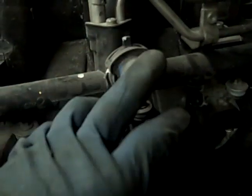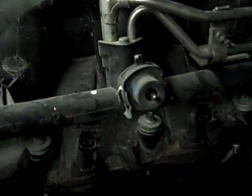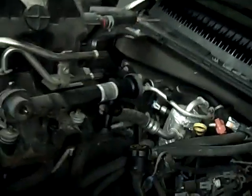In order to pull the intake manifold, you have to pull the bolts along the side. You also have to undo the harness for the fuel injectors, the fuel pressure regulator, vacuum hose, and then also the hose that goes from here to the valve cover — the backside for the PCV system. I also need a quick disconnect tool to take the fuel lines off.